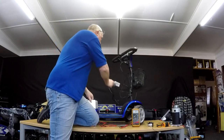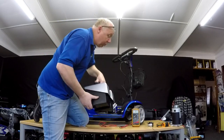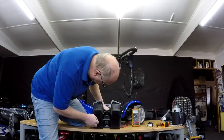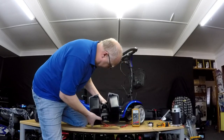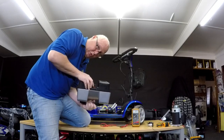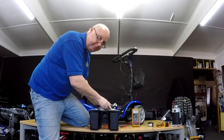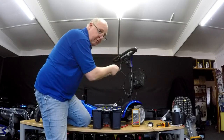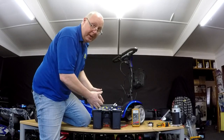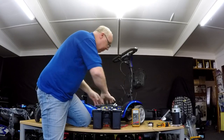If you have a battery pack like this one here, some of them have fuses in them. Most of them have fuses or circuit breakers of some kind. There's a spare fuse in there — that could be your charging fuse socket. This one's red, which is 10 amp, but some of them have fuses inside the battery. So if you come along and you've got zero volts, it could be a fuse that's blown because of dampness or a small power surge that could have blown the fuse.